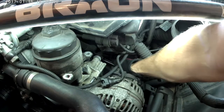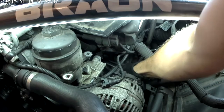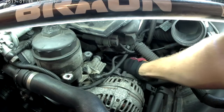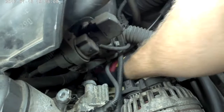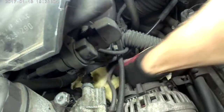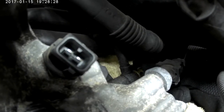It is very difficult to get a ratchet in there, especially if you have larger hands. You'll need a short stubby ratchet or something you can move nimbly. It's a good idea to have a rag or towel there to catch any oil drips. Once you've broken the bolt free, it's easier to simply finish it by hand, with the rag ready to catch any oil.